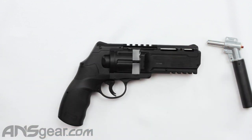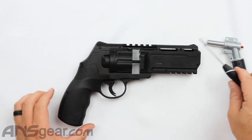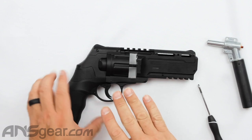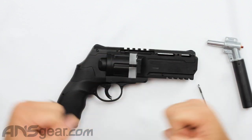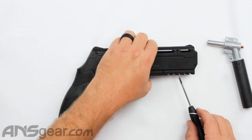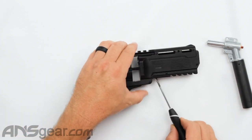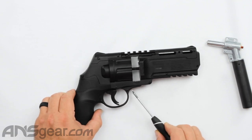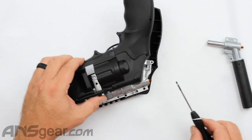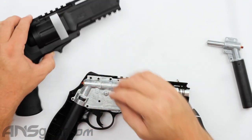From here, you'll want to have a couple things: a flathead screwdriver that's relatively small and thin, and then maybe a larger flathead screwdriver as well. We're going to work our way around and wedge this into the crease that runs all the way along the side here and separate these two halves. I do not recommend picking it up and trying to manhandle it and pull it apart. You want to be as ginger and gentle with these as you possibly can. I usually start up at the front, look for a little opening, slide in and rotate. Sometimes they pop apart pretty easy; sometimes you have to go around and around until you finally get it to come apart.